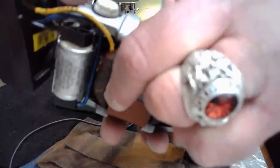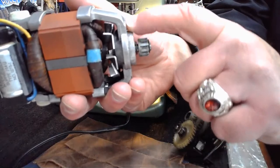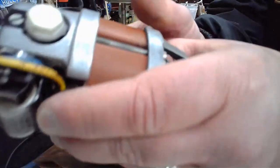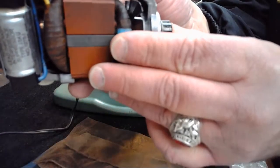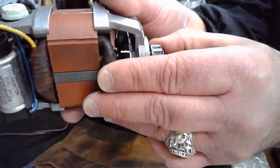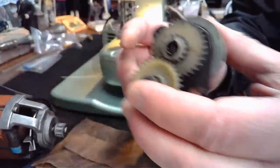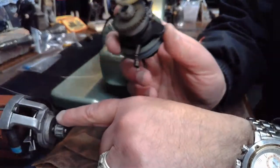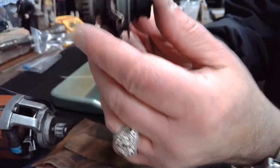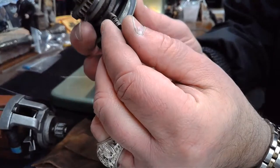So especially if you have a machine that is having issues with this rubber boot on this end that our friend AW is referring to, it goes right over this area, kind of holds this motor in a fixed position. If you're having issues with that, you may be able to compensate, assuming that the motor is just out of alignment a little bit and it's not pitching every time you push on the foot controller, then you've got more of an extreme issue going on. But what you can try to do is you can try to manage that until you can come up with a solution for that rubber boot issue. You can try to manage it as this is in the machine, this little spring right here, and this one is kind of deformed. This is not a usable spring.